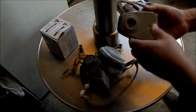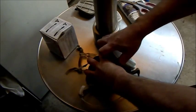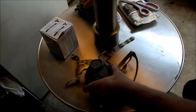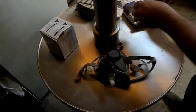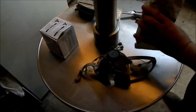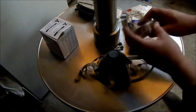I don't know how these come apart — I might have to cut it. We're going to replace it with new stuff. Now this mask, when I use it, it does smell a bit thinner-y, so I know it's had it. I'm going to put this new set of cartridges on. There are rubber gaskets and a one-way valve so you can drag air through but it can't push back the other way. It's always important to get the right cartridges — there are different types. This is an organic vapors one, so it's right for spray painting, and they just click over.